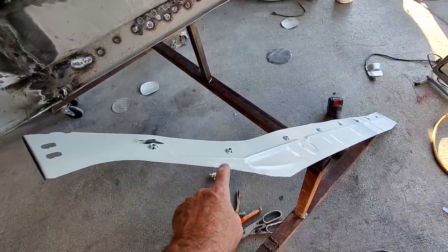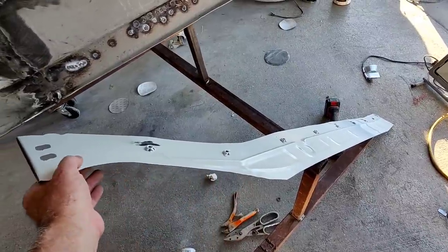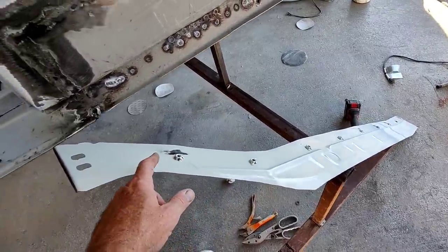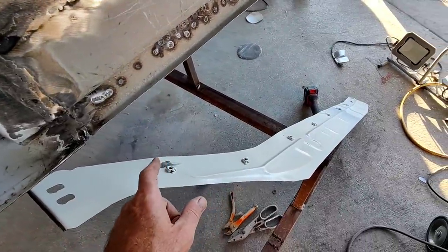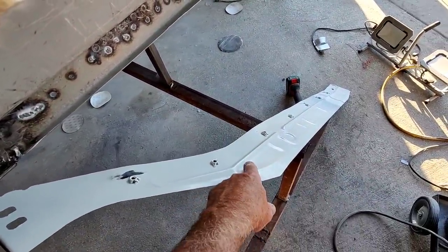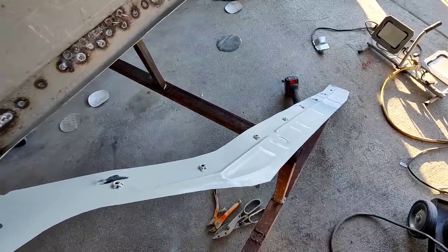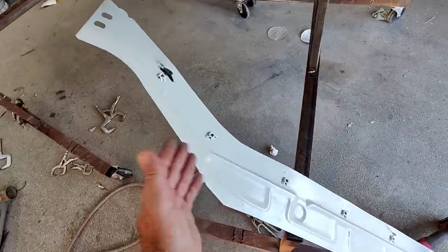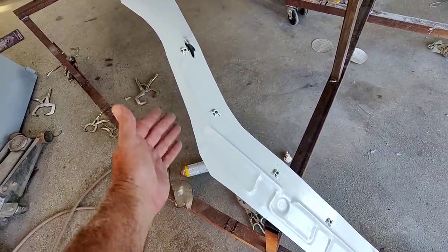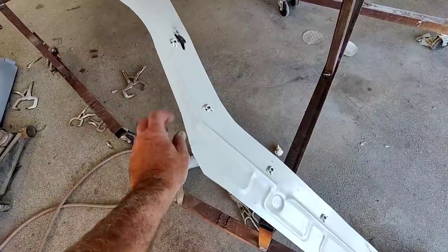And panel adhesive is very strong. If you put a lot of clamps on it, you made sure you got a lot of clamps on there if you're going to use something like that. Then the other issue it will solve is that it won't rust on this panel, because you won't weld it and it won't get hot. And some people say, well, that's not strong. You know, it's your opinion, whatever. It's your car. You decide those things for yourself.